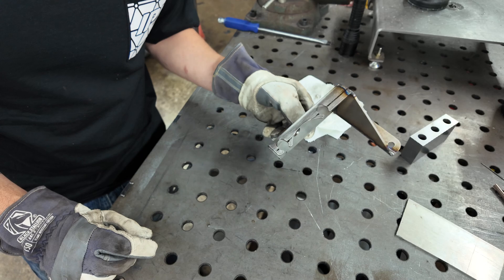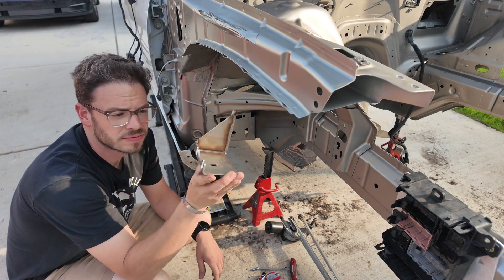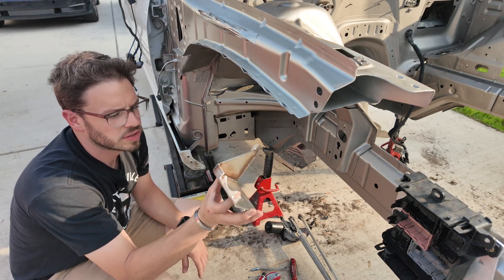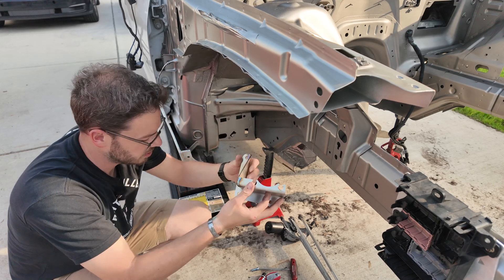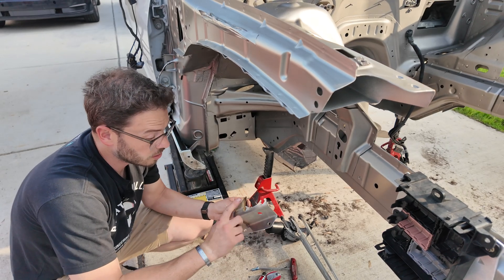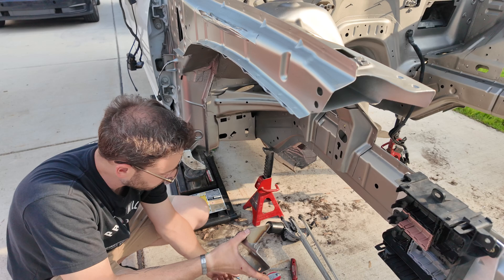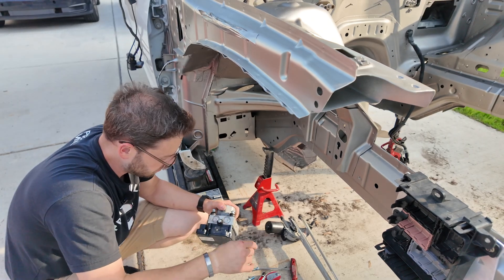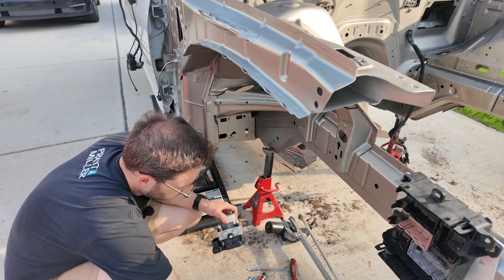I've got one more welding project to do, and then I'll get this bolted onto the car, swapped out for that 3D printed guy that's on there. This bracket turned out pretty sweet - very similar style to the original bracket that used to be in the engine bay, and the bend from SendCutSend was pretty easy. I welded on the little side piece and that turned out pretty decent. I'm going to install the ABS module onto the bracket first so I can make sure the grommets go through the holes, then I'll bolt the bracket on. I got some Loctite to help hold it into the rivnuts, just because this is kind of important.